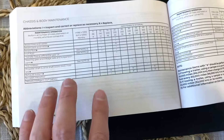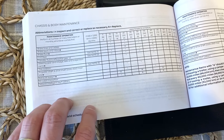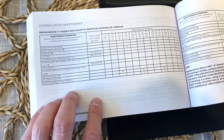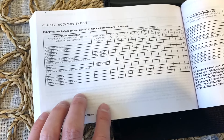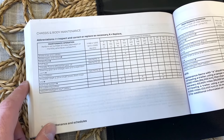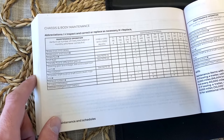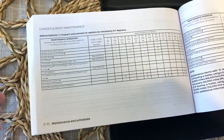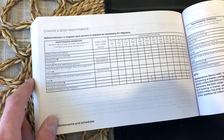So we have a little bit of mixed messaging going on here. Since we also don't have a dipstick, this gives a really clear indicator that they are not really wanting you to change your CVT fluid, or at least to do it at the dealer. The recommended change interval is 60,000 miles, which is roughly in line with other transmission and CVT fluid replacements — 60 to 80,000 is typical.